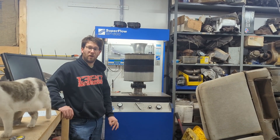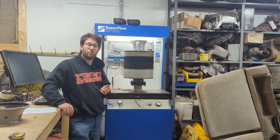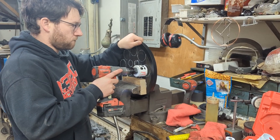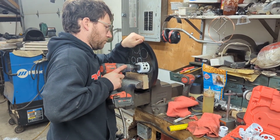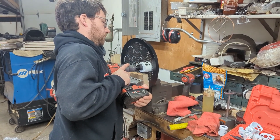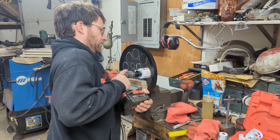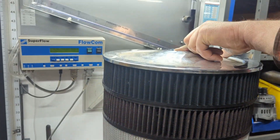The Edelbrock has a 1-inch pleat depth versus the RPC's roughly 1 and 1/8 inch. We don't have any data on filter efficiency or how well these catch particles — some may do better than others for filtration, but as far as airflow goes, more surface area typically wins. The exception is the disguised surface area, which we'll continue to investigate in the next video. As much as I hate the idea of running without a filter, based on how big the gains are, I'd consider running without one at the track.